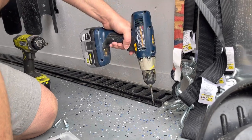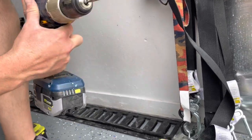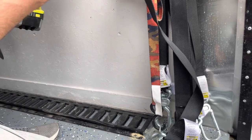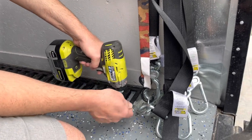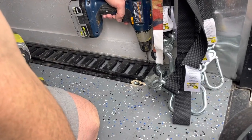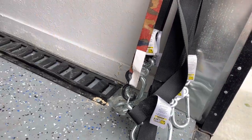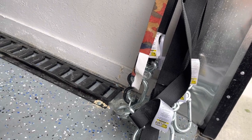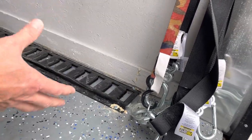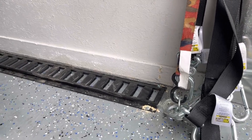I'm going to use a pilot hole — make sure you get a good sharp new drill bit. The self-tapping screws will break on some of these, so you want to do a pilot hole. Then we're just going to go down the line and drill all these out. It's also helpful to go underneath your trailer and look to see where the studs are and if there's any extra bracing places you can screw into. If so, it makes it a lot easier to place your screws.